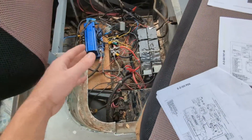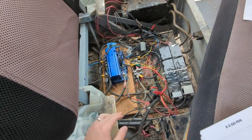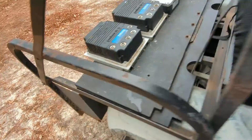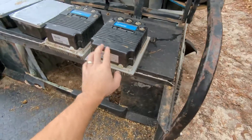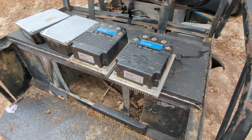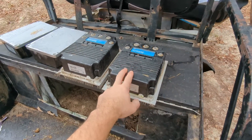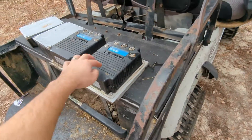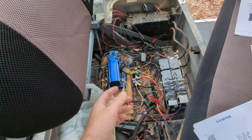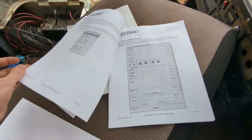I have 10 of them, so theoretically if the motor wants 1000 amps, these batteries can give the motor 1000 amps. The problem is the motor does want 1000 amps. Since these controllers were designed for lead-acid batteries, all of that amp pull to the motor is too much for them and they burn up — there's no current limiter inside. The Alltrax has a little current limiter you can set through the software.